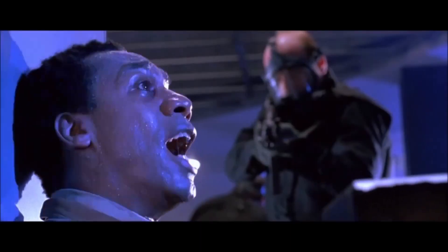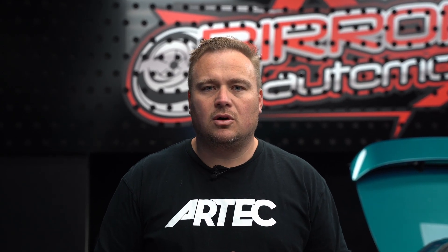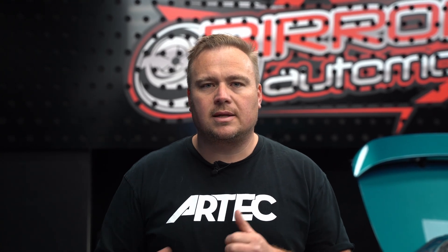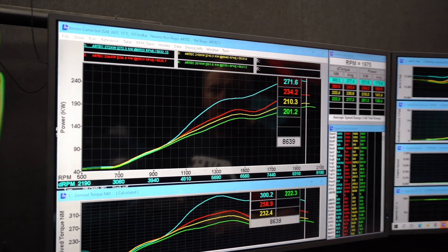What we did then was we started to add more boost — we changed the wastegate spring and the Turbosmart 45mm gate, and started to increase the boost pressure further. But we've now hit issues with the clutch slipping. From now we're going to add some more sensors to get more data on the turbo dynamics, back pressures, inlet pressure, temperatures, water temperatures, things like that. We'll switch out the clutch to a twin plate OS Giken item and get back to the dyno. The goal is to try and get to around 350 kilowatts.